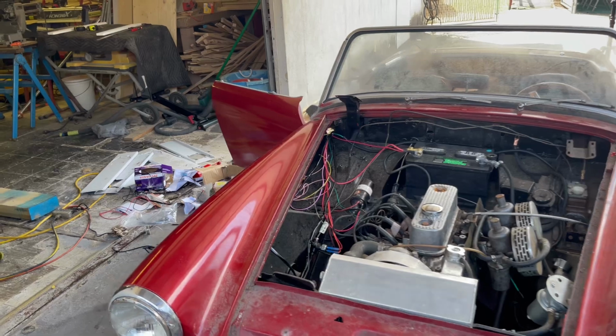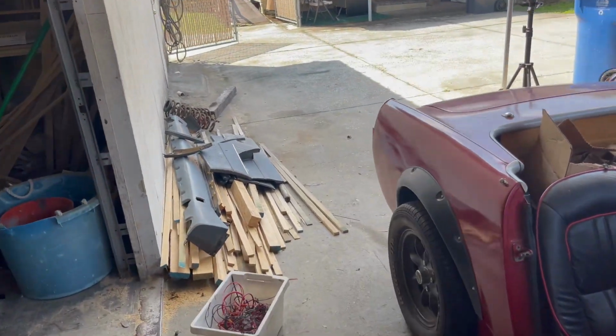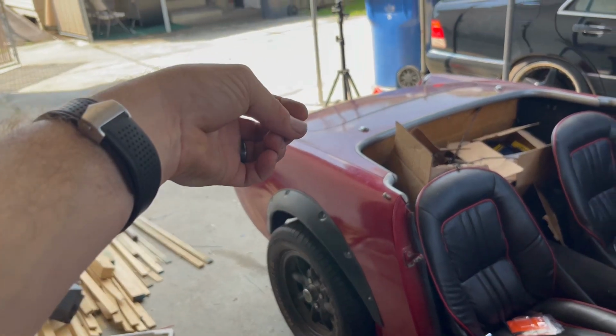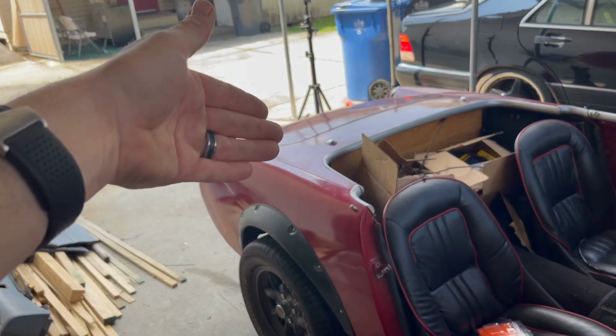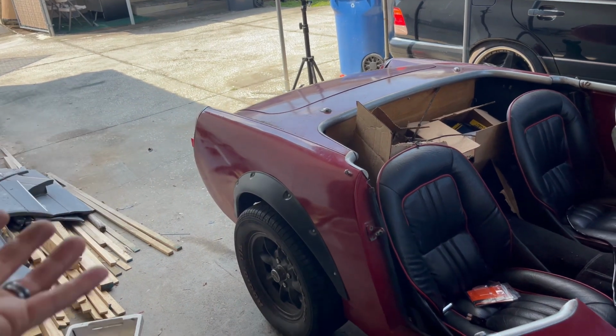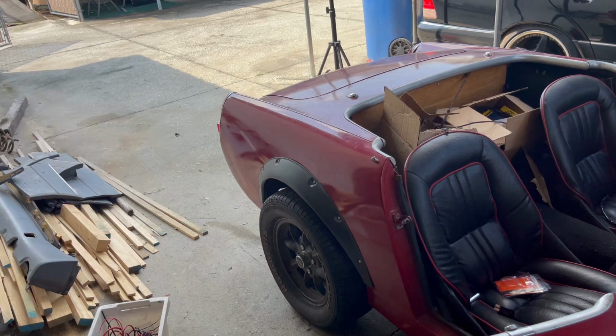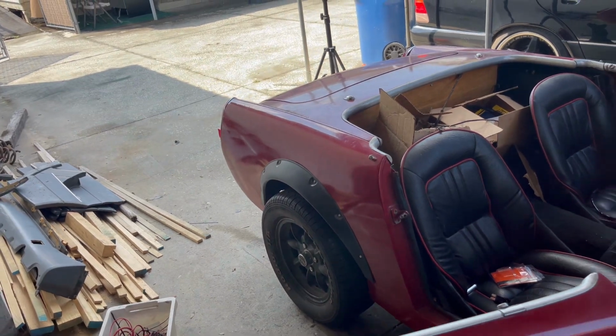Another thing I did is the rear brakes were completely blown out on this car. So I cut them off. I actually plugged off the line that goes back here. So right now we're running off a front brake. So we will be able to drive it. It does stop actually pretty good. And I did order in all new rear brakes. So the next video after this, I'll be installing those or off camera.